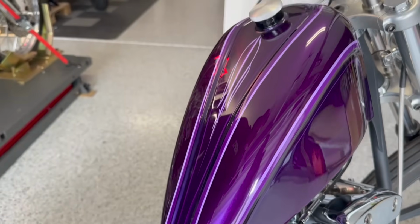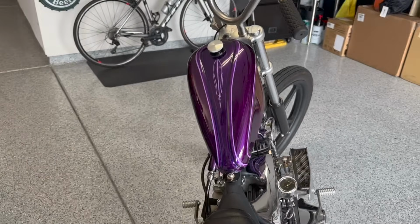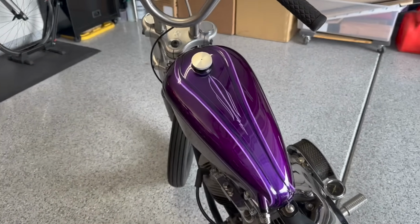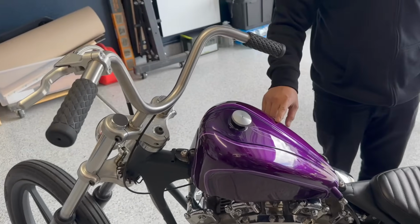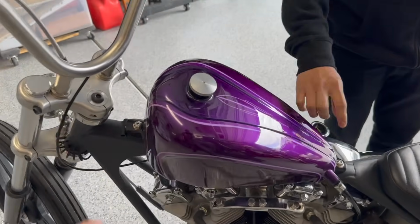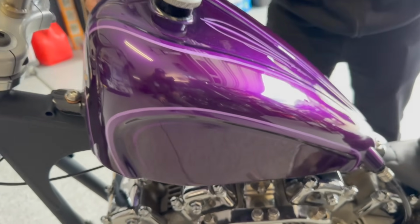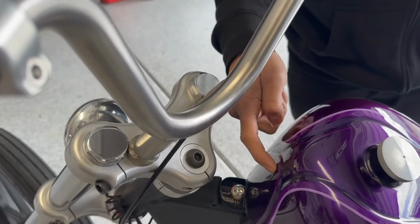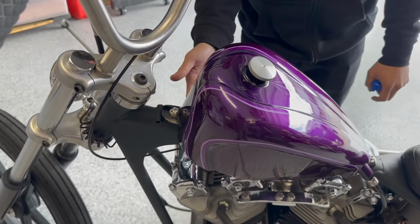It's hard to see right now, but when it's sunny, you totally can. How big is the tank, dude? Is it 2.1? I think it was normally a 2.1, but a little more narrow. There's a guy named RKB that built this tank. So it's dished on this side, dished on the top, he dished the two sides in, the bottom's flattened out. The tunnel actually sits all the way up here. The tank was supposed to sit all the way down, but I wanted that Frisco look.